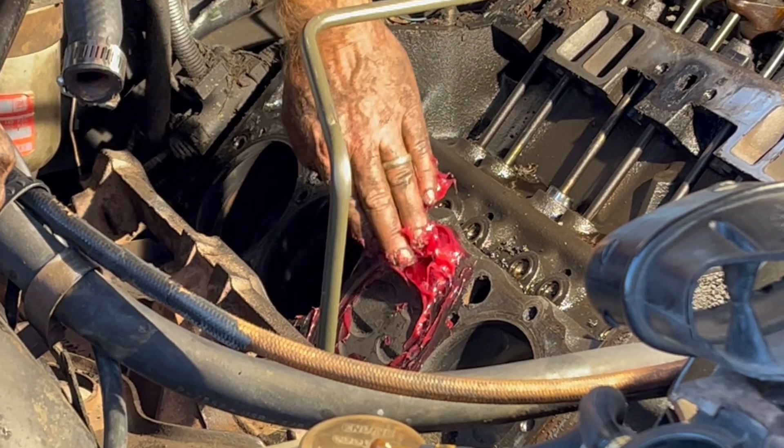As far down as 9.5:1 I don't really care, but we also don't want more than 40–50 thousandths of quench. If I've got 35 thousandths of gap between the top of the piston and the cylinder head surface, I really don't want more than about 20 thousandths of gasket on top of that — that puts me at 55 thousandths total. I want a thin head gasket. If I have to go thicker, you can get detonation and pinging.